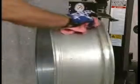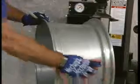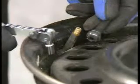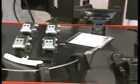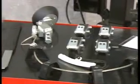Take care to adhere to the following mounting precautions. The rim must be clean and in good condition. Remove all wheel weights. Replace the valve stem or replace the O-ring if the valve stem is made of metal. Use only an approved lubricant for tires. Make sure the tire is the correct size for the rim. The Monty 3550 is equipped with all the accessories needed to change the most difficult tire and wheel assemblies.